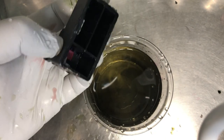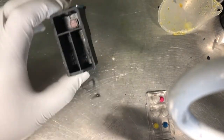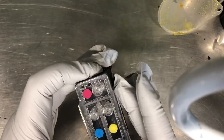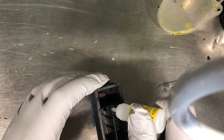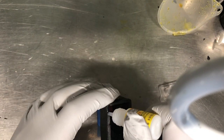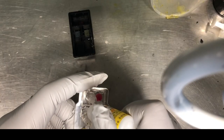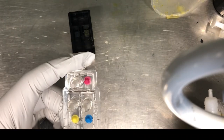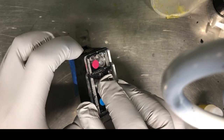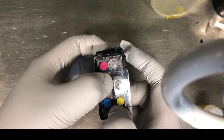So we're going to regrind this and put a new cover on with the super glue. Before we put the glue, we want to try the cover on a few times to make sure the cover fits. Let's start doing the T first, just in case we forget it later, and then we do the borders. Then we fill the groove in the T with the super glue. Make sure the center T is solid black, with no air bubbles at all. If something is wrong with the edge, you can fix it, but in the middle, there's nothing you can do.